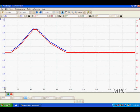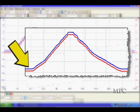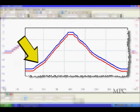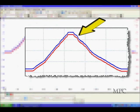Here's a replacement sensor for the one we looked at earlier that had a glitch, but we need to look at this a little bit better because there are some other things to talk about. Do you see any minor inconsistencies in these waveforms? Let's magnify it. They're not always the same distance apart — they're pretty steady, then get up here and get close together, there's a little dip, then on this side they spread apart and get close again.